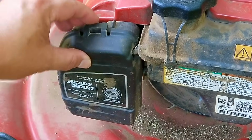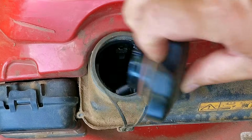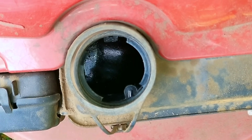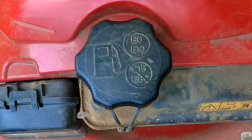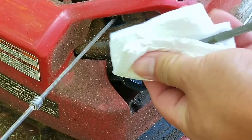It looks like the air filter was changed at some point, and apparently the spark plug was also recently replaced in an effort to fix the issues with the engine slowing down. Now, I do have to applaud their efforts because most people wouldn't even do anything, most would just keep using it until it stops. They also told me they added oil to the engine, but they're not sure if they put too much in though.